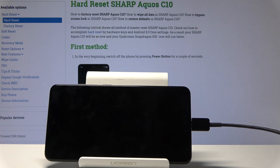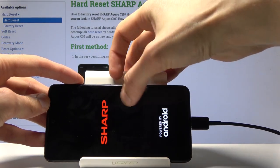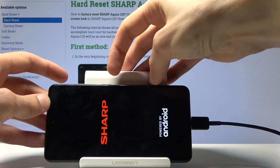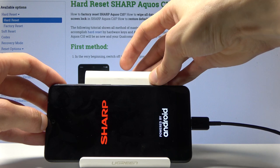Once it's off, you will then hold the power key and volume up together. Disregard the Sharp logo — it's not actually turning on. It's going to show the battery status in a moment if we wait.